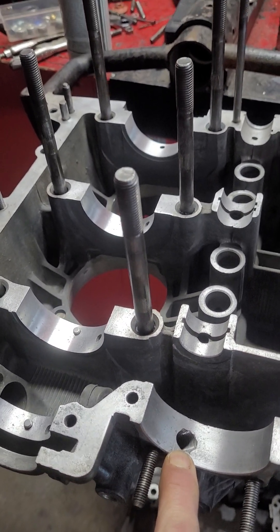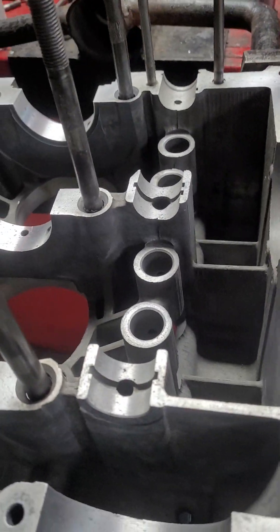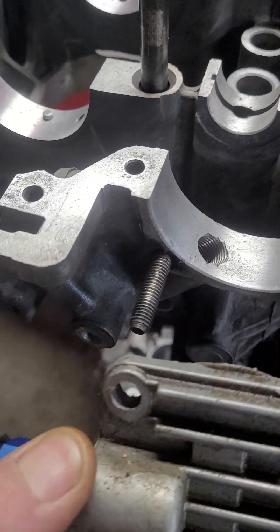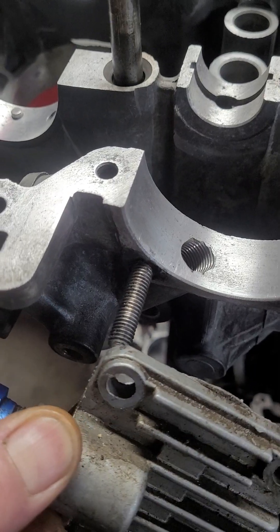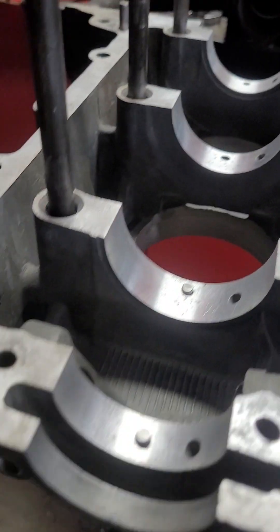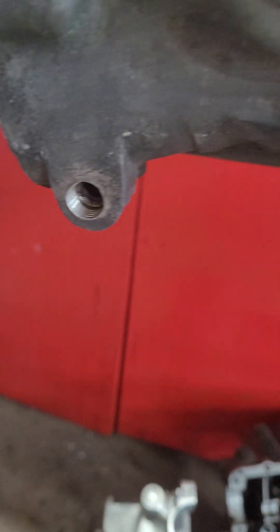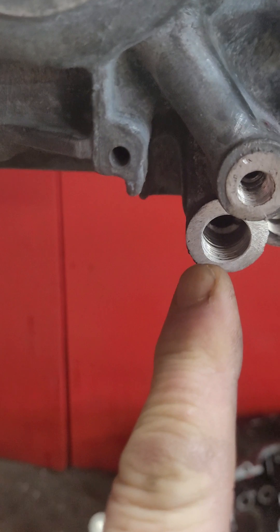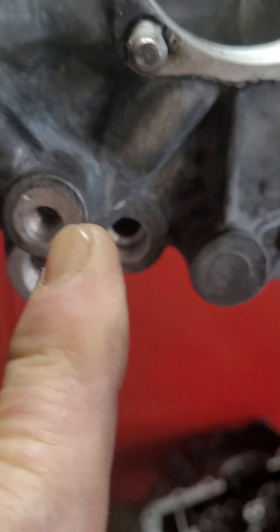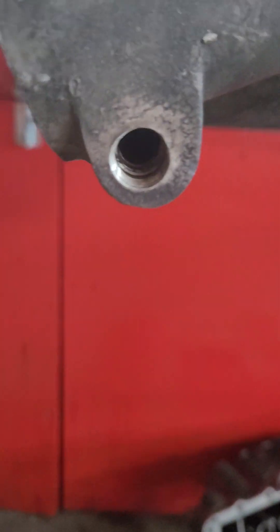Something I've done here, and I've found in the past, is if you do a full flow on your engine where you're using an oil pump and rerouting the oil out through an external line to a filter prior to it coming back into the block into the main gallery. You can see I've drilled and tapped all the holes in this to be able to clean the galleries out completely.